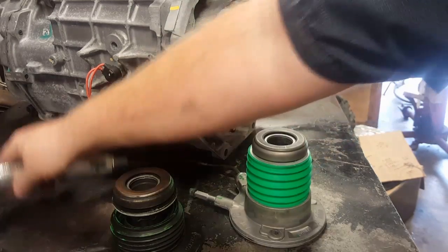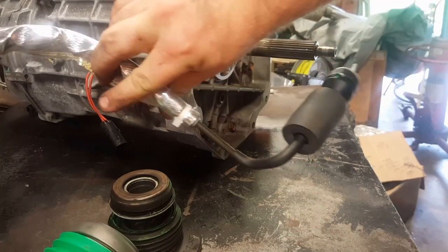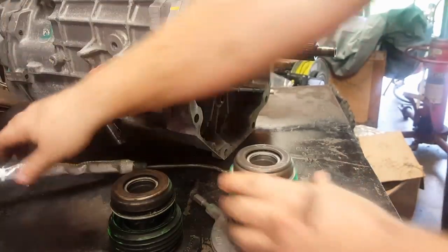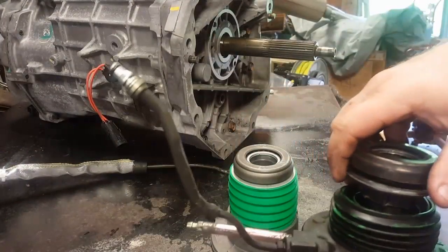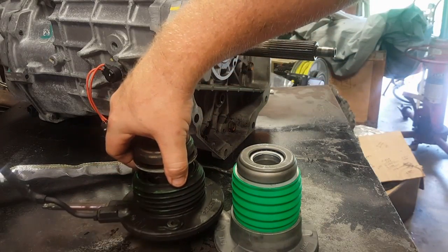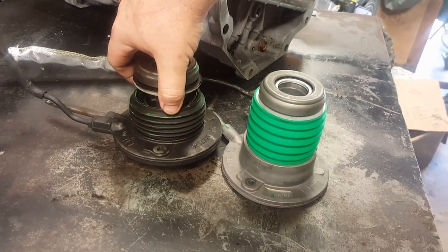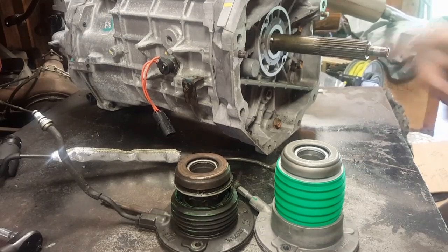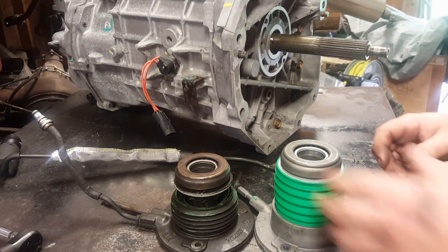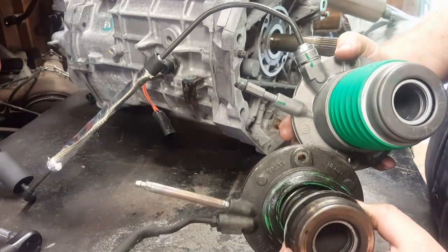But as you can see, the hoses, the piping coming off the side of them is a lot different. That's all one big piece. That's the C6, this is the CTS-V, and a lot of guys run a spacer down here to get this thing brought up. That's the problem — the gap on the bottom there to make up the difference for that flywheel. The biggest thing you want to do is be able to measure your distance from this to your clutch fingers. That's what I want to show today. Also, the difference with this is it's got a shorter bleeder, so you have to swap that over.